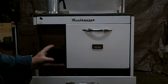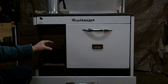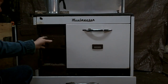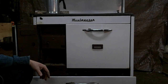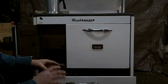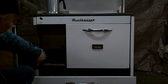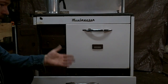With the firebox burning, your fire needs air, so there are two air controls on this stove — one that controls airflow into your fire and one that controls airflow for your oven. Like a regular wood heater, a draft control determines how much air comes in: more air means faster burning, and you can cut it way back for a low burn. On this particular stove, there's a lever on top that slides a grate back and forth on the side to control my airflow.